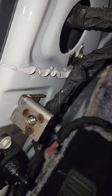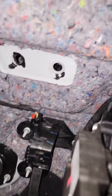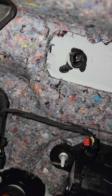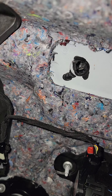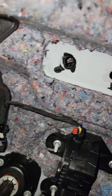There's a bolt down there that comes through the firewall. On the opposite side, if you still have your windshield in — which I do, it's already been replaced — this could be a pain. I used extensions with the impact. The one on the right, which would be on your left from the outside — I had to use extensions with a swivel to get to it, and once I got it so far I had to unscrew it with my fingers.